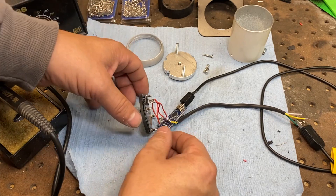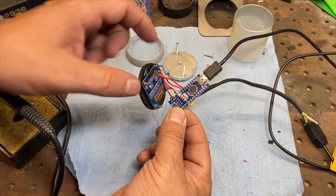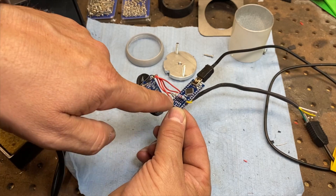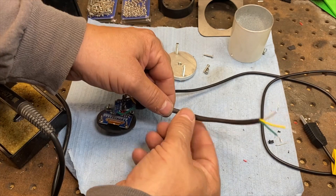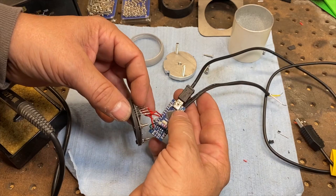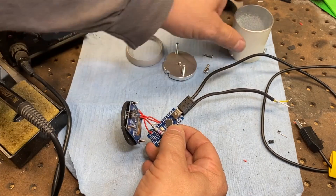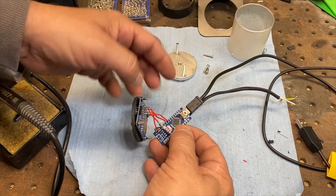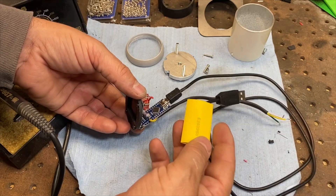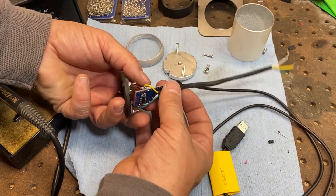During final assembly I soldered all the wires directly to the terminals. I soldered the 4.7K pull-up resistor directly from the D2 pin to the 5-volt pin with all wire connections directly soldered. A wire comes out the back of the gauge for quick connectors to the temperature probe sensor pulled through the firewall. I also trimmed the USB cable since it was a bit too long to fit in the housing properly — it'll sit crossways in the gauge. I added heat shrink over the terminals so nothing vibrates loose.